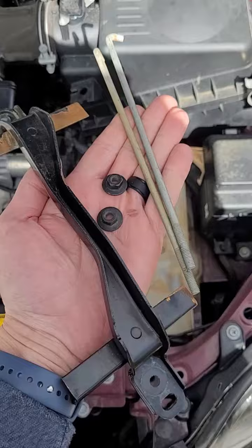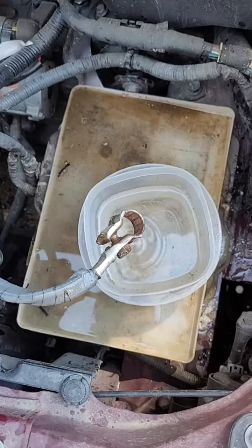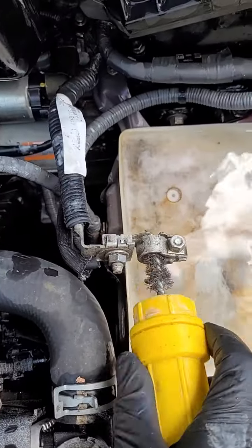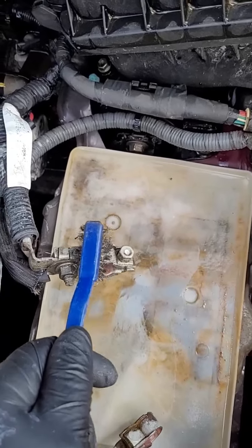You can see how much better these look now. I use the same ratio of baking soda and water to clean the battery tray and any areas that have battery corrosion. Use that same mix to clean the cable ends, and give these time to fully soak in the solution. Use a wire brush to clean the inside of the terminals — if you do a lot of these, it's easier to just use a drill. I also use a wire brush to clean the outside of the cable ends.